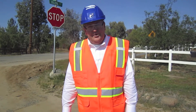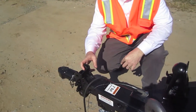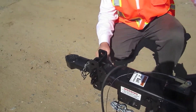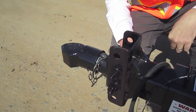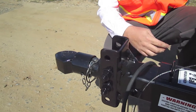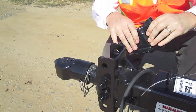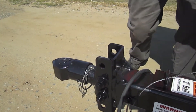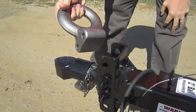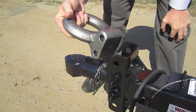We're going to show you, starting from the tongue, our different hitch options. You got a fully adjustable hitch for different size vehicles. This is a standard two inch ball coupler — you got three different heights. By removing two bolts, we also have a two and five-sixteenths ball coupler. We also have a fully 25,000 pound pintle hitch, which will go on there very easily.